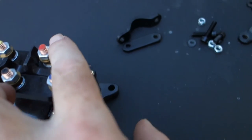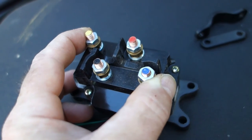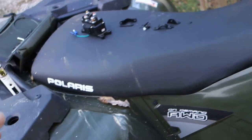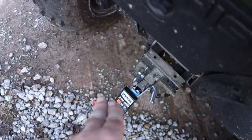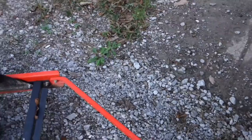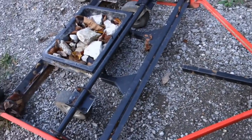On the other end, color-coded plugs go to the relay, and on top of the relay you have red and black for battery positive and negative, and blue and yellow going to the actuators. The plan is to run the battery wiring to the relay, run wiring back toward the rear where the relay will be mounted, then run wiring along the frame inside tubing back to the actuator — bypassing the DR Power Grader's battery and remote and going to a hardwired system on the Polaris battery.